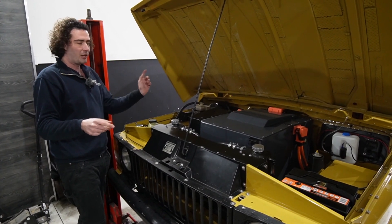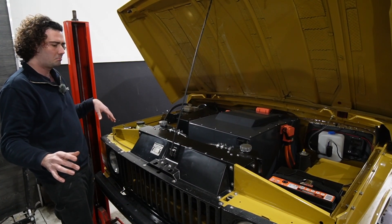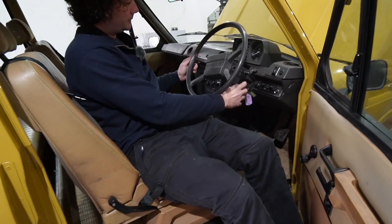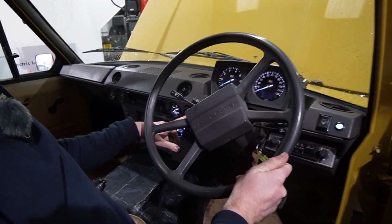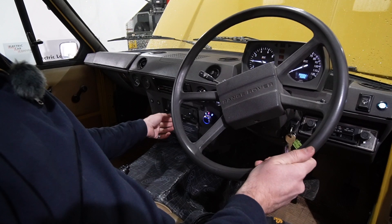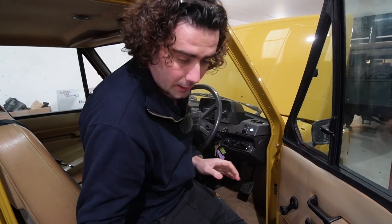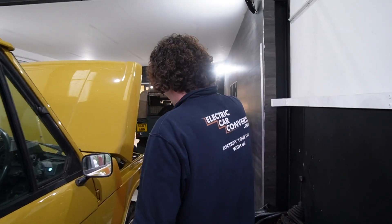Fast charges in 25-30 minutes, it's got power steering, it's got cooling — two separate rad packs in the front. If you come inside, we've got the original key. It flickers on as soon as high voltage goes present. We've got nice gauges showing battery level, battery temperature, amps and speed. Select the gear there, original heater matrix and everything, so you can turn the blower on etc. We've also got heated screen, power steering, things like that. All pretty good. Charge socket looks pretty cool too — that's a bit of Toby's genius. So that one's done — that's the one that's leaving us next.